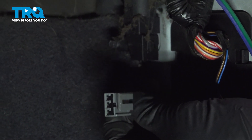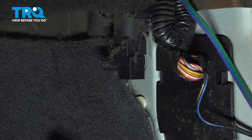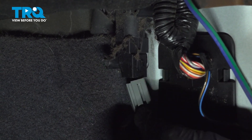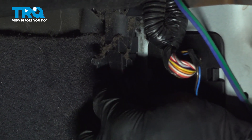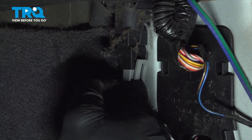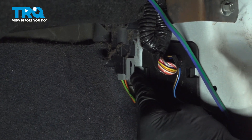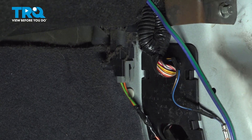Give it a quick check for corrosion and set that aside. Once you're sure you've evacuated the fuel pressure from inside the system, make your way back under the dash and reconnect this. Listen for a click. Give that a tug to make sure it's secured. Continue on with your trim piece.